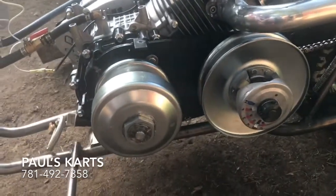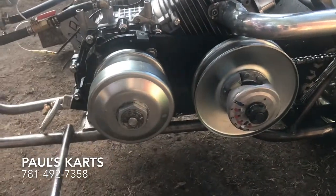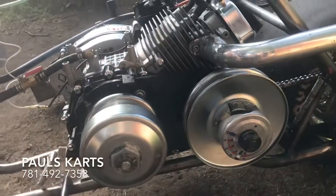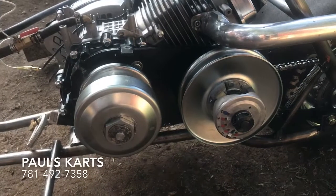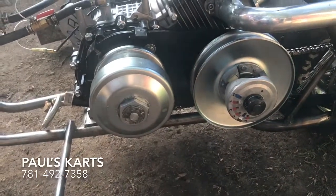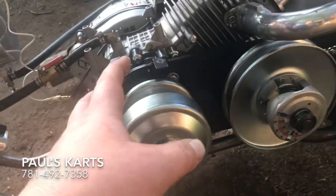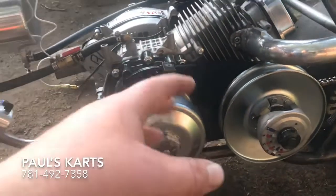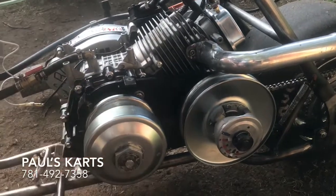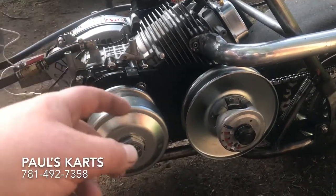That setup ended up working perfect for me — and I'm a 300 pound guy, so you'll have to adjust this stuff for yourself. If you do have an original Comet belt and have this set up properly, you shouldn't be having belt problems. Even as a 300 pound guy, the belts last a decent amount of time. Just don't get these cheap eBay $20 belts — they're not worth it unless you're only making a few horsepower or you have a stock engine with the governor still on. Once you pull the governor and are spinning these things hard, you'll end up blasting belts. Rock original Comets — I'll put a link in the description.